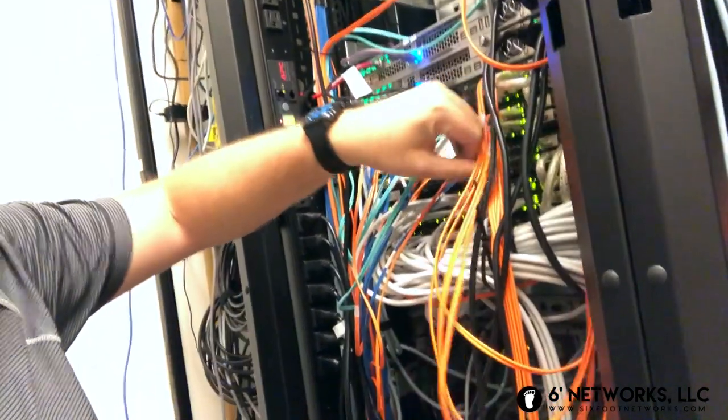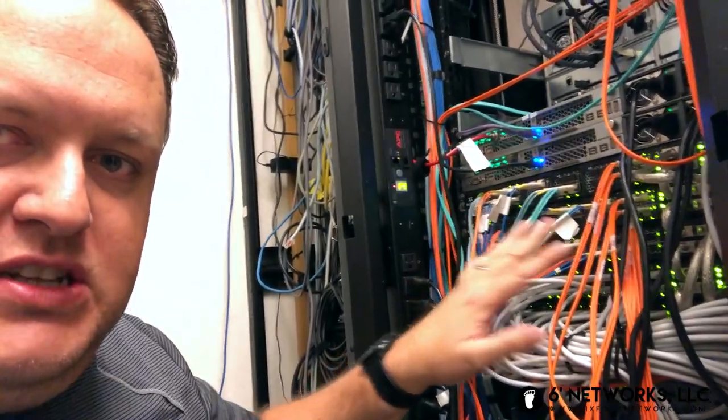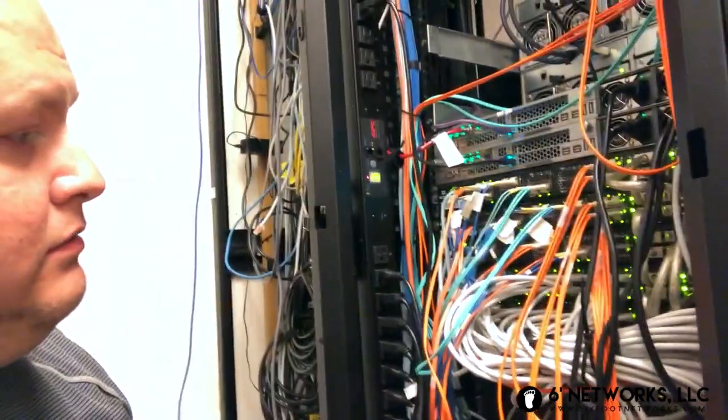In this case we're talking about fiber channel, and basically you can see here this bundle that I'm holding is all of the cabling that I'm referring to as being kind of out of date. You can see that I've slowly started installing some of the optical multi-mode cable here. I've noticed that certain parts of the SAN are performing a little bit better because this cable is only rated to 4 gigabit. So I'm starting to remove that and hopefully I can double the performance, at least in theory.